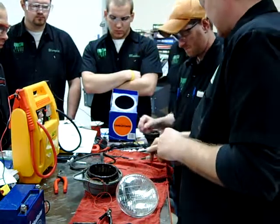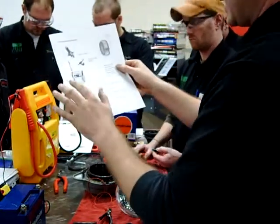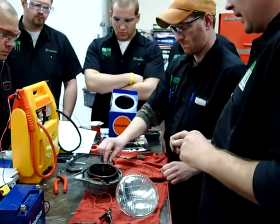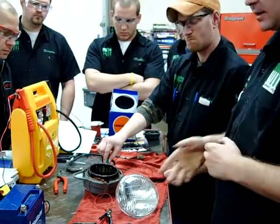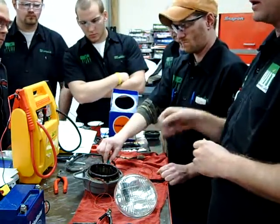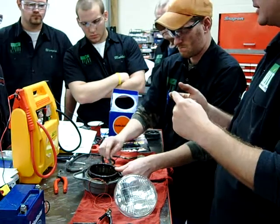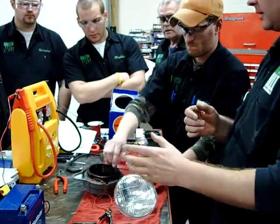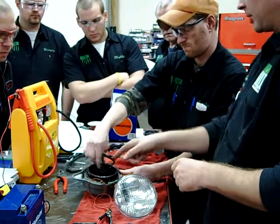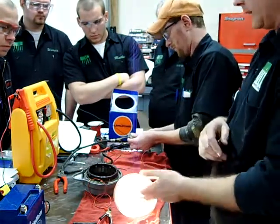So now the final test: we're going to stay attached here and take our ground wire. If you flip your lap sheet over to the back — we leave our positive hooked up, we come off the stator now, and we're going to touch the frame or the core of it. We should not light, so we know that we're good. Pretty cool? If this does light right now, that's a problem. Wouldn't you agree that you should never just test in one spot? So let's try some different spots. Did you have to check all three legs too? No, because they all had continuity to each other — remember, we just tested all three. They're all good. If one's bad, the whole thing's bad. Touch the inside ones — we've got nothing. Now, to prove a point that our test hasn't been altered, hook it back up to one of those leads — go to the middle one this time. Light's on.